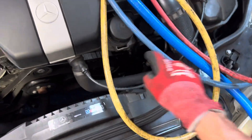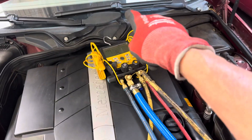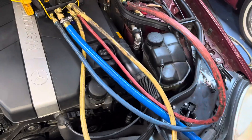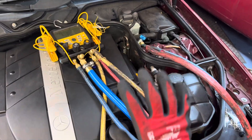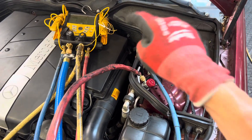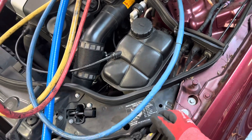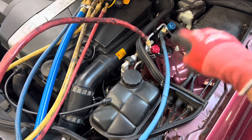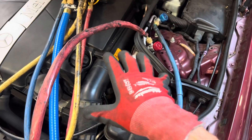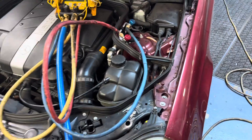There is nothing in the condenser, nothing in the receiver-dryer, nothing in the lines — especially the discharge lines out of the compressor, which will be bone dry like the desert. Then you go back to the evaporator and it's full of oil. Somebody commented on the Facebook group that oil doesn't leave the compressor and doesn't mix with R-134a. That tells me this is a paper person, not a reality person — a service manager, service writer, or shop owner who tells other people what to do but isn't physically pulling the evaporator out and pouring the oil out to see it happen. Oil absolutely travels in AC systems and logs up in the evaporator when refrigerant is low.